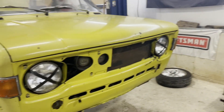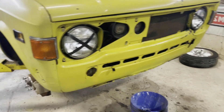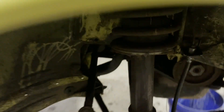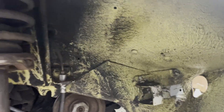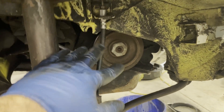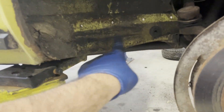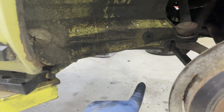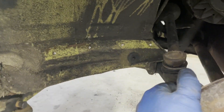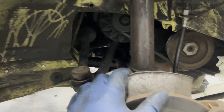You also need to remove the grill to access the two bolts here and the two on that side which hold the hood hinge on, so if you want to remove the hood you do those bolts and it comes right off. I put tape on the headlights because race car - just being goofy. The inner fender liners are out, which is nice. I took off the cover that protected the belt and pulleys just to access the engine. There were splash guards riveted here - a metal bracket at the top and a big rubber splash guard on both sides - and you can see the four shiny rivets I drilled out.